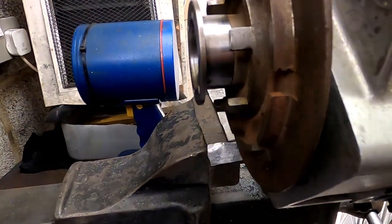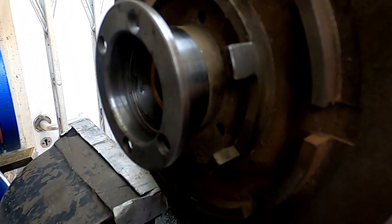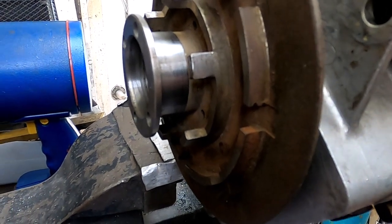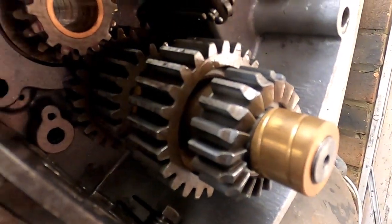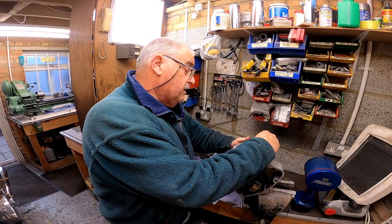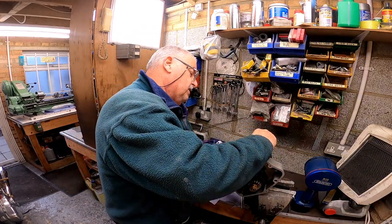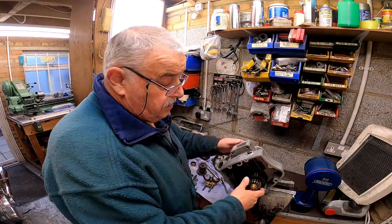Right, this shows the clutch and the spacer and that threaded ring all clamped down on its spacer, which means that in effect the sleeve gear is tight and fully engaged in the bearing, and it's in its final position. I'm just going to take this sleeve gear out again. I'm happy with the mesh, but I feel the need to talk a little bit about wear patterns on gear teeth, and what we can sensibly hope for when we're building something which is mature.